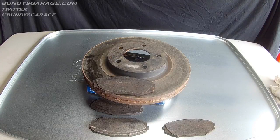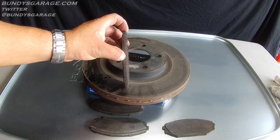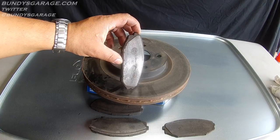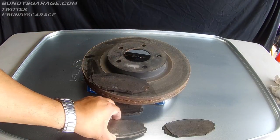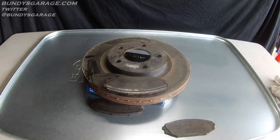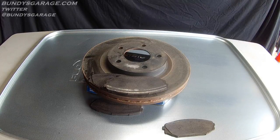Quick tip on what to look for when changing out your brake pads and rotors: check your caliper pins and you should see this kind of even wear. These brake pads barely started making noise when I changed them out — I actually found it by going in reverse and stepping on the brake. Probably because they started shifting around inside the brake caliper.